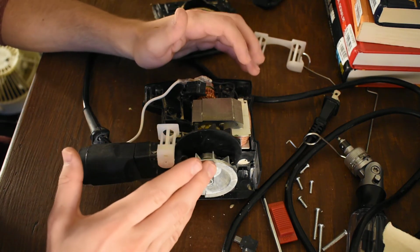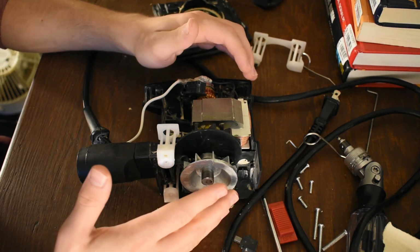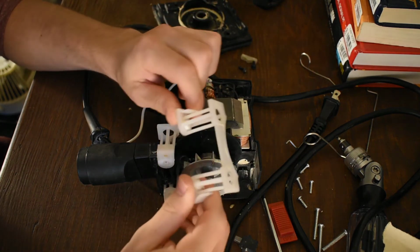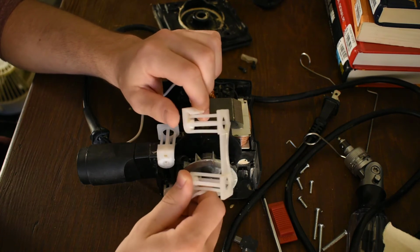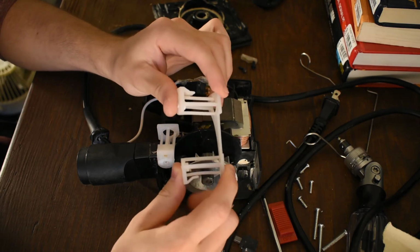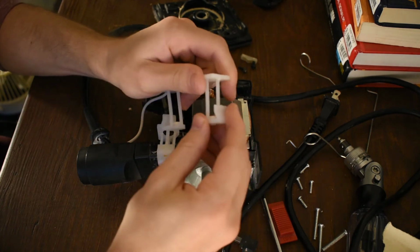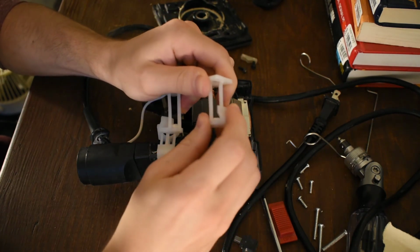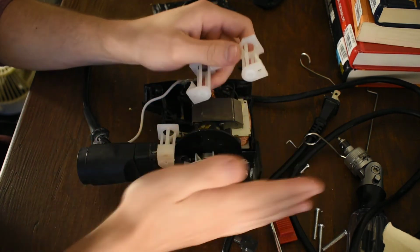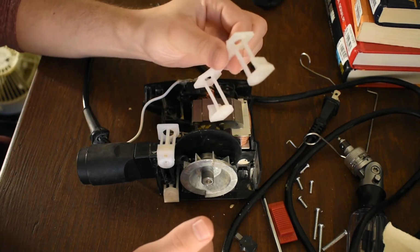Don't buy a quarter sheet sander. The principle of how the sandpaper is affixed to the sander is bad. It just doesn't work. What else can we learn from this? This is polypropylene, this piece right here. Because if this was ABS, like the clamshell, it would break. ABS, we talked about, is brittle. It's also rigid. So the purpose of this is to flex. This is designed to be bendy and allow the thing to move side to side while still being somehow mechanically attached to the sander.